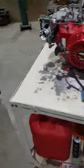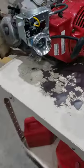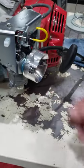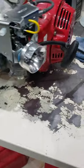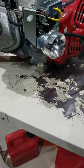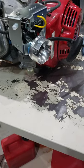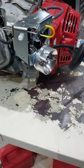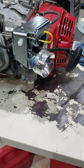And so, if you're gonna modify the air intake, then you have to go to something like this round adapter for a round hose. This is the reason we had to extend the studs to use this. It was close to being long enough, maybe an eighth of an inch longer would have worked. I guess if it wouldn't have had this auto choke housing on there, it would have worked.